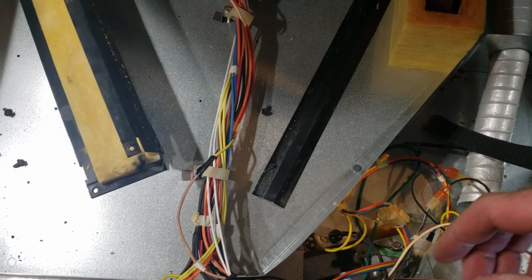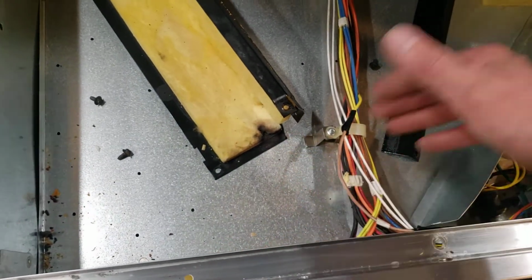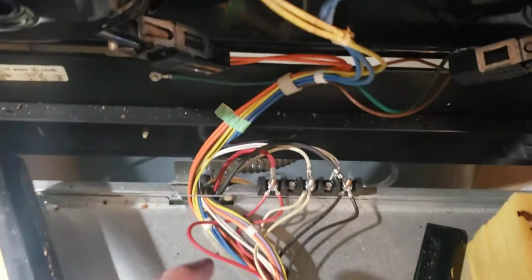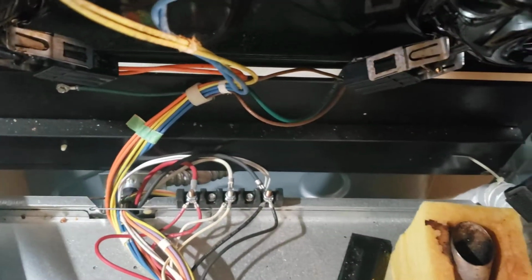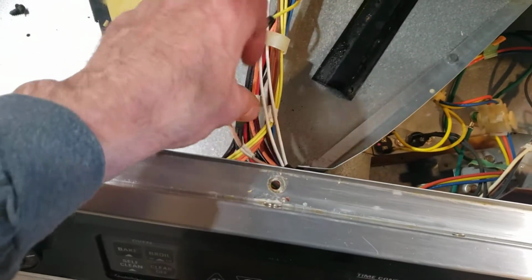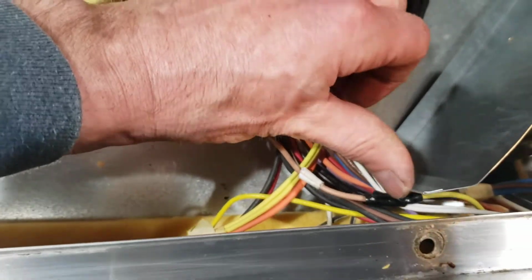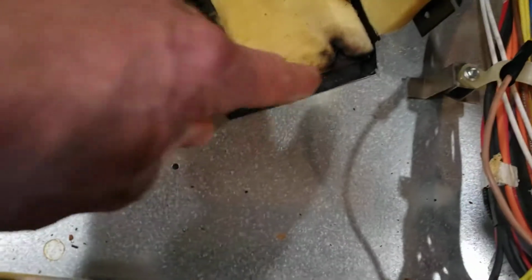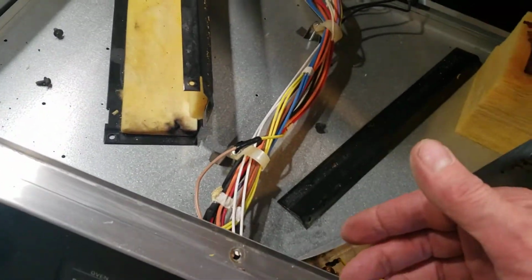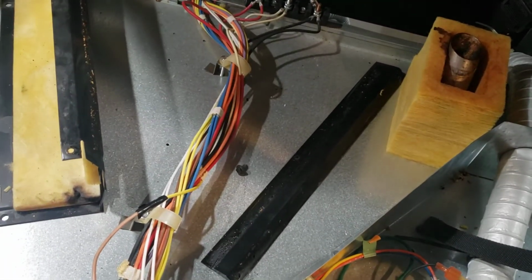A lot of times there's a cover panel here, or at least on the machines in my area, I see a cover panel here, and you can pull that out and get at everything. But here I had to take all this stuff apart. So like I said, all your wires are going back down in here. I metered that, I wasn't getting any voltage, and what I found was a blown up wire here. It was short circuited, and I went ahead and replaced that wire. It's just from years of rubbing against this, even though it's rolled over and it's not a sharp edge, it just blew up there, and I could see evidence on the insulation. It's kind of a difficult machine to work on because you have to pull all this stuff out, whereas the other one I mentioned has a cover panel, you can get in there and meter. But again, it's the same for all different brands. You just have to trace back to what you're looking at.